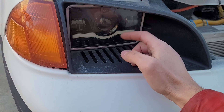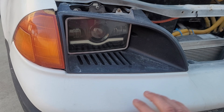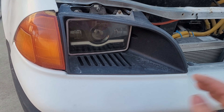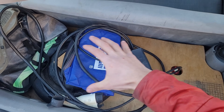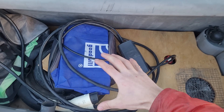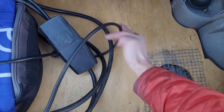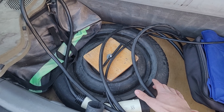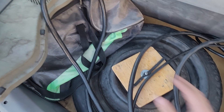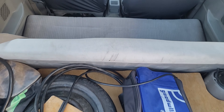Headlights were upgraded to LEDs because they're better — you can see further and they consume less energy, meaning the car will drive further. Back here in the trunk, there's the other half of the battery, which is identical to the box up front — it's sitting underneath here. Here is the charger and another cutoff switch. The spare tire did have to be relocated up here, so a little bit of trunk space is lost and the jack is here, but there's still quite a bit of trunk space and you can still fit two people back here.